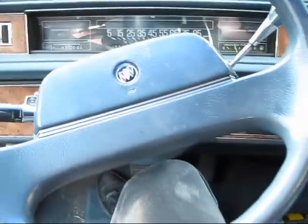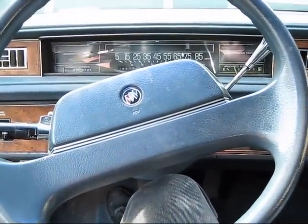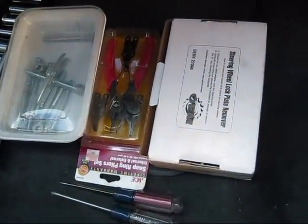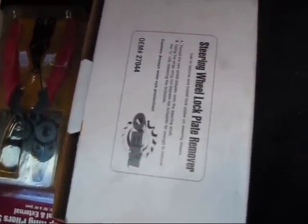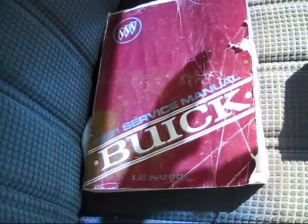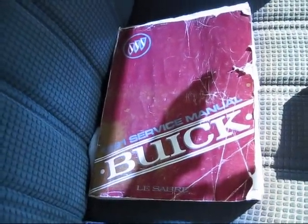Got nothing. So I'm going to have to take my whole steering column apart and replace that. To do this job, you're going to need a steering wheel puller, a snap ring plier set, and the steering wheel lock plate remover — you'll see where that comes useful. Also very useful: a service manual, especially if you're not that familiar with taking apart a late model column like this.